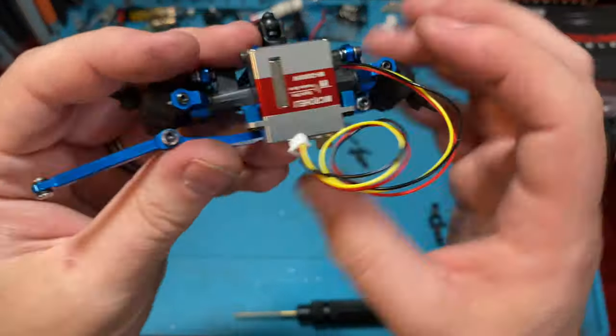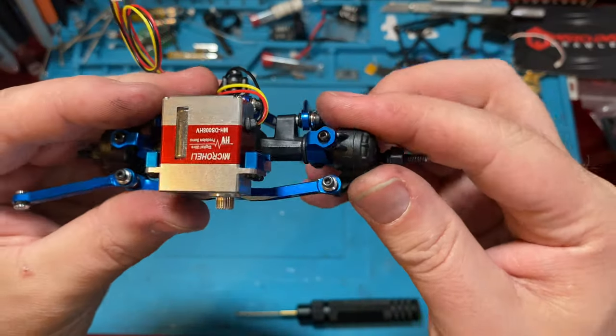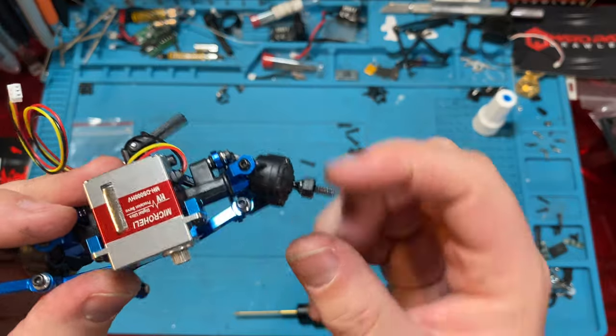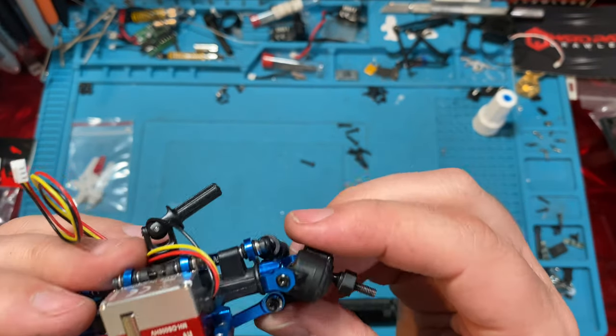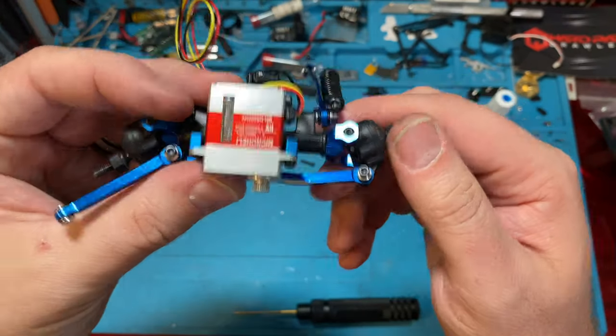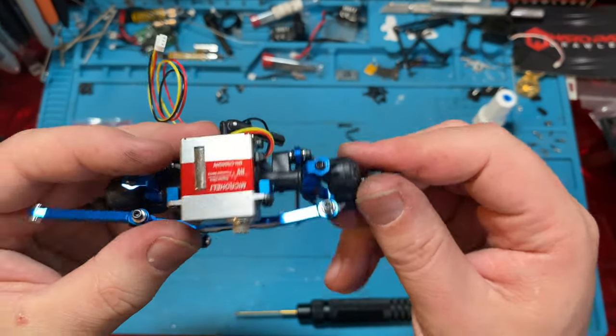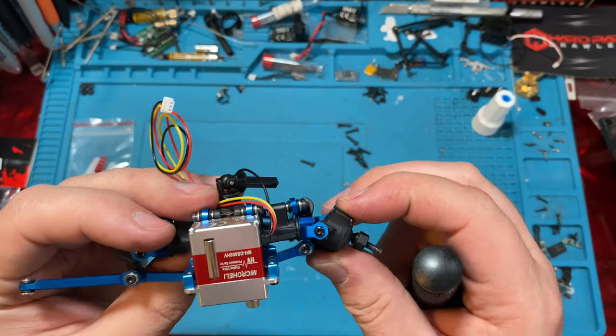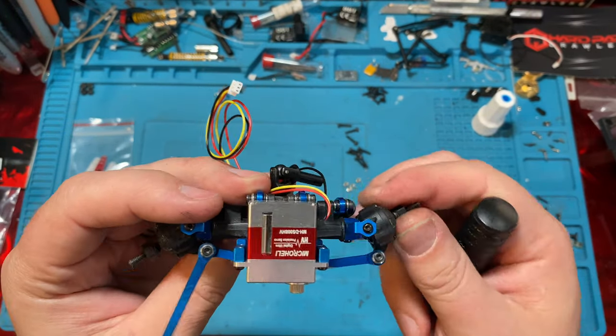See, if you're able to put the screws behind, I know it's hard to see, but the steering link hits on the screw. And if the screw is in the backside, then you get more turn angle. So I guess it doesn't really matter that the knuckle was hitting here if they're going to have the screw there anyway. So it's probably about the same as stock.